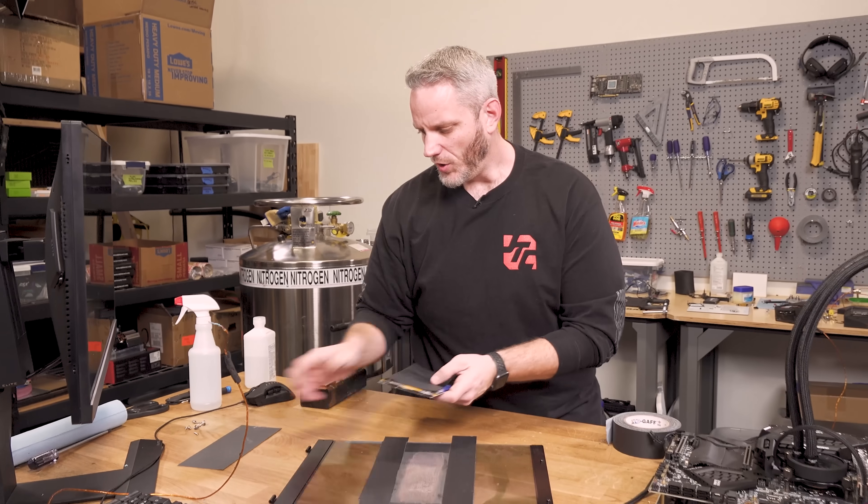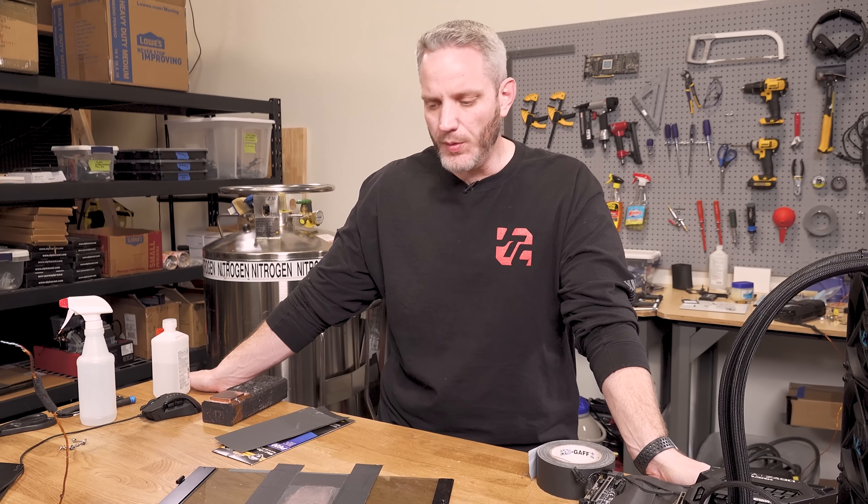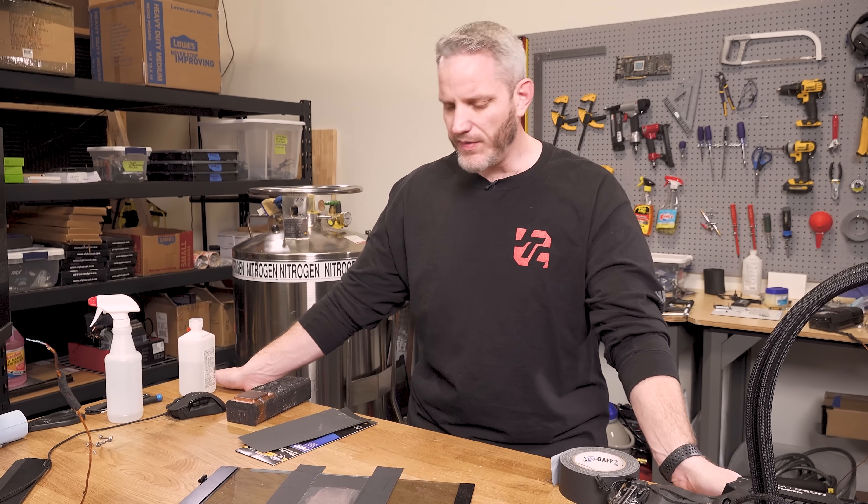You can see the scratch marks in there — you can't really feel them with your fingers, but they tell me it's going to have some texture for the thermal paste to stick to. It's kind of like trying to paint something that's polished — the paint isn't going to really stick because it has nothing to bite to. The same thing goes for the thermal paste; think of the rough texture as sort of like the primer.